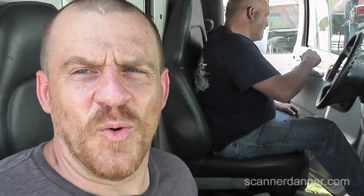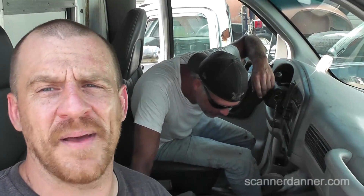All that other social stuff — you'll find Tim Weiss there too. Thanks, Tim. Peace, catch you later. Okay, so we're not done. I told Kate to get out of my video. So now that we got this thing running, we want to know why is it misfiring? And I don't feel like grabbing all my high-tech equipment. Let's just stay with a test light here. We're going to do a basic RPM drop test with the test light.